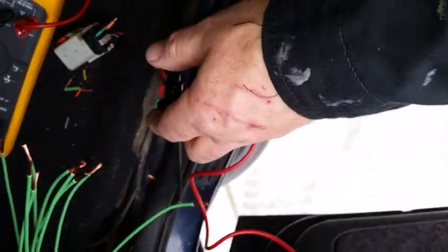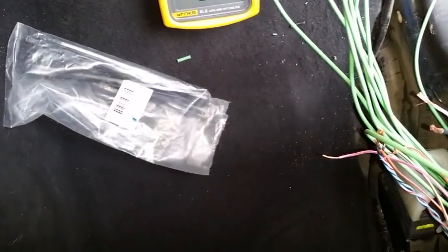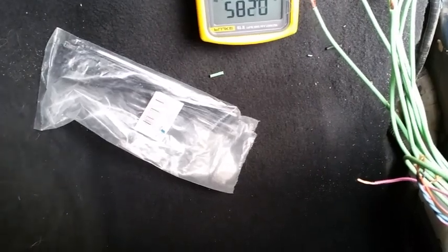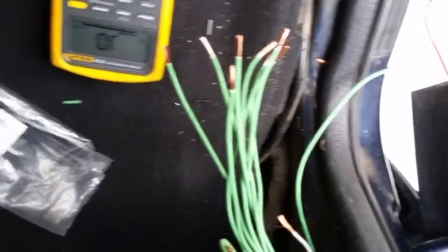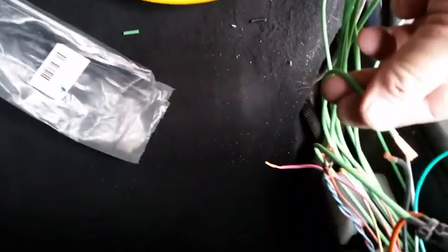I'll tell you right now, it was out of the 9 wires left, possible 9, 1, 2, 3, 4, 5, 6, 7, 8, 9. Yeah, last one. So, you know, it just goes to show you, you get to bet on that. Like, what's the chance of getting the last of the 9 possibilities? So, that's the wire. This one will go to the original black wire. Both are 12 gauge, so you can get the yellow wire nut.